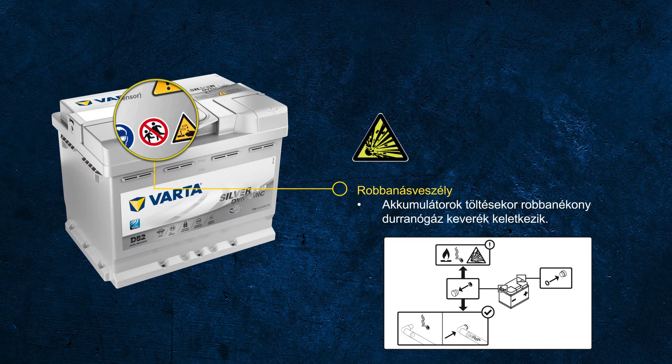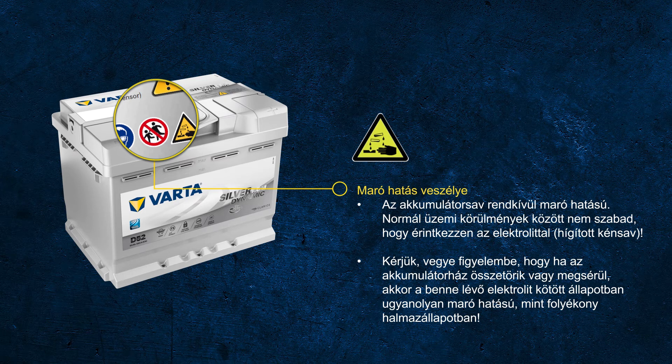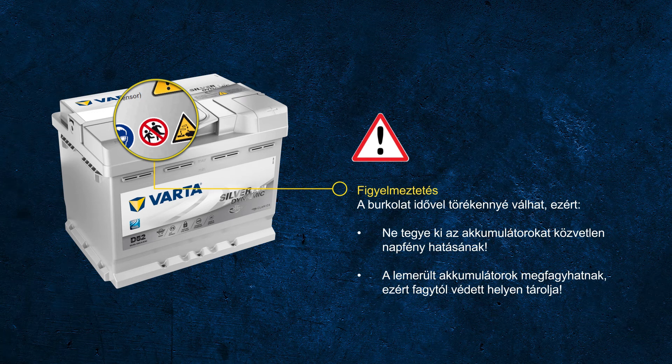Hydrogen is not the only reason to wear protective goggles. From the CCA test we already know that the battery is able to deliver hundreds, or even more than a thousand amperes over a pretty long time. Protect your eyes, skin, and clothes from electrolyte — the acid is extremely corrosive. If you detect any leakage or moisture, be careful while handling and also protect the environment. Free acid could leak and damage the paint on the chassis or the vehicle. Old batteries that have been heavily exposed to sunlight or freezing might become brittle and could break.